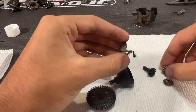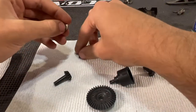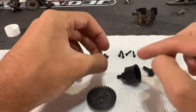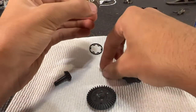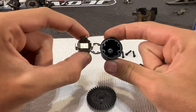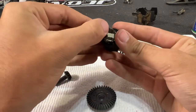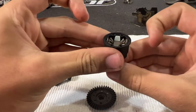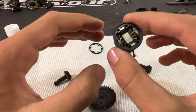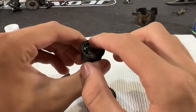There are two little spacer tabs — I'm not sure what they're called — that have two teeth on the end. The teeth face up toward the open side of the diff. Put one on each side of the gear, still facing up, then put this whole assembly into the diff cup with the I-beam facing the correct way. There are two screw holes on each side — line everything up, push it all the way down, and it should all spin nice and free. This is where you can really see where that I-beam support and the metal tabs come into play — they add rigidity, fill in empty space, and eliminate flex in the differential.